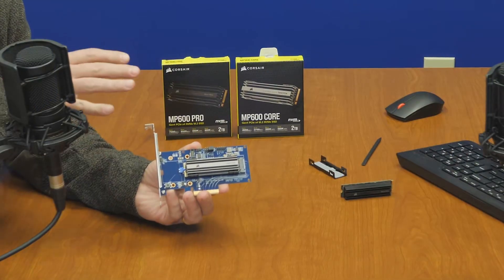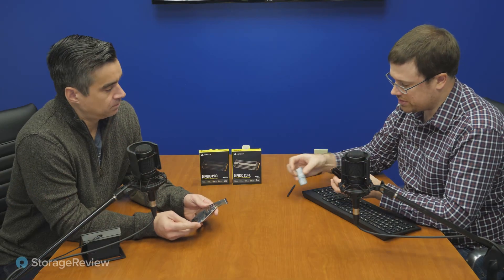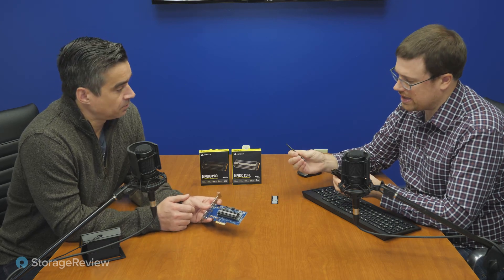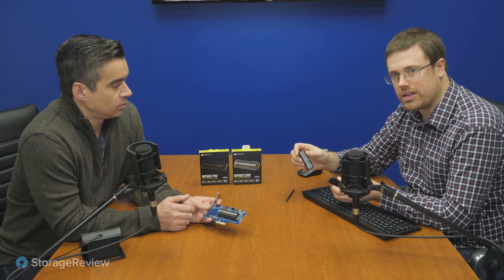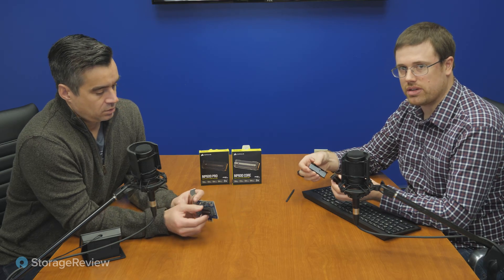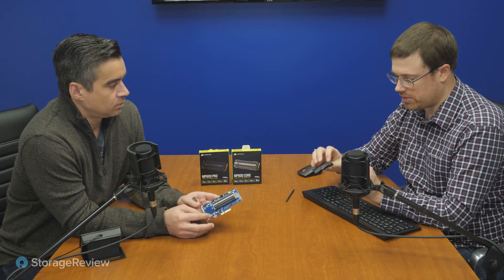Let's talk about the build. The drive sits in a PCIe adapter card, and both come with heat sinks clipped on. It's not difficult to take apart — you don't really need many tools. We used a little plastic spudger, like a plastic pry bar. Some drives have the SSD glued or stickered to the bottom, but these just have a normal thermal pad. The pad gets a bit mangled if you remove it, but you can if you need to.